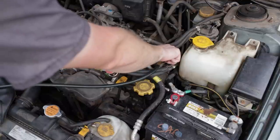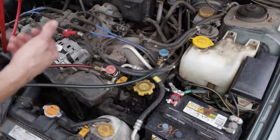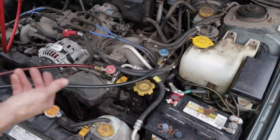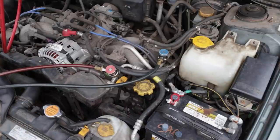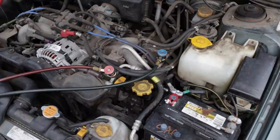It's a good thing we didn't just assume the system was empty because the AC wasn't working — as you heard, there is a refrigerant charge in this system. It may be too low for the AC system to activate, but we don't know until we recover it and see exactly how much was in there. After recovery finished, there was only one-tenth of a pound recovered. Most likely that was residual refrigerant pressure in the hoses from the machine sitting in the shop and being hot — not the actual charge coming out. The system is empty.